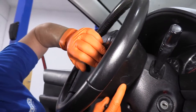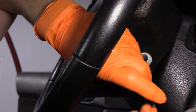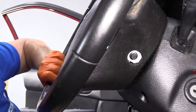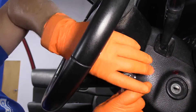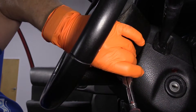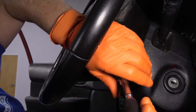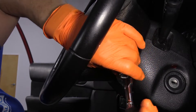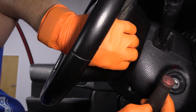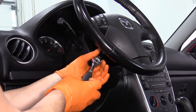Got to remove the plastic cover that hides the mounting bolt for the driver's side airbag. That is going to be an eight millimeter socket. Just break that free. Repeat the process on the other side — there's one other mounting bolt located almost directly across on the other side.